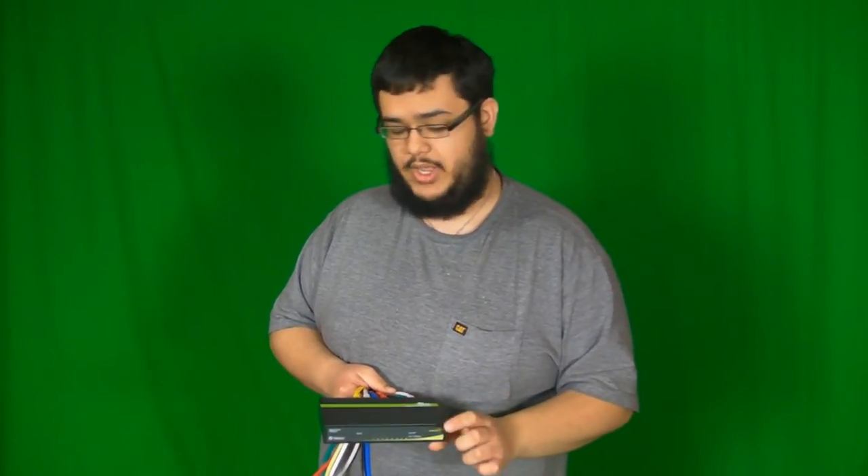I know some people don't like the TrendNet brand, but I've never had TrendNet before, and on my first reactions for this brand, I've got to say I'm very impressed. This thing has eight ports. It is a gigabit switch — each port can do one gigabit per second. But this is also a full duplex capable switch, which means that the one gigabit speed pertains to both upload and download, technically meaning each port can do two gigabits per second total, and with all eight ports maxed out, the bandwidth is 16 gigabits per second.